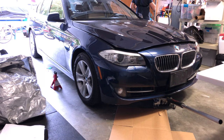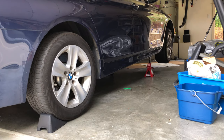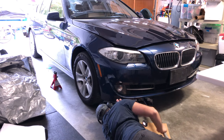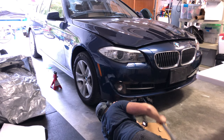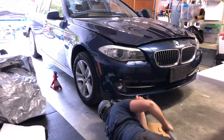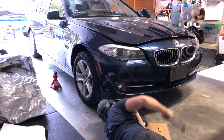Set the parking brake — this is very important — and then put chocks behind both tires just so there's no chance of it rolling or moving. Then we'll put the main jack underneath the front of the engine and look for the metal exposed part underneath that plastic there, and we'll lift the car up pretty high.